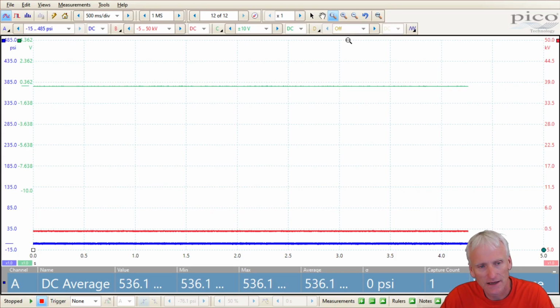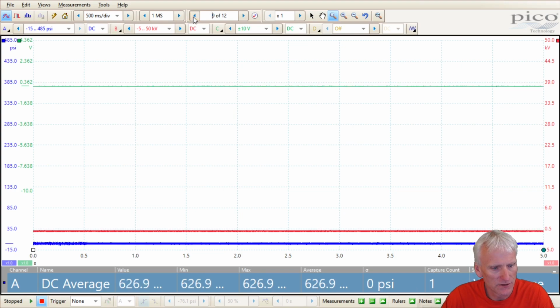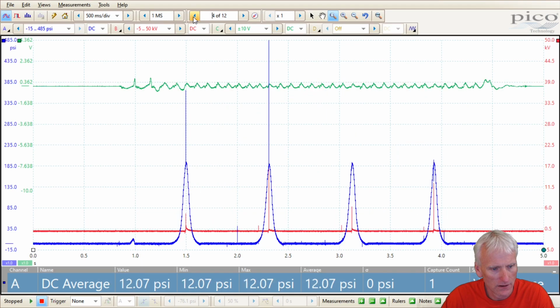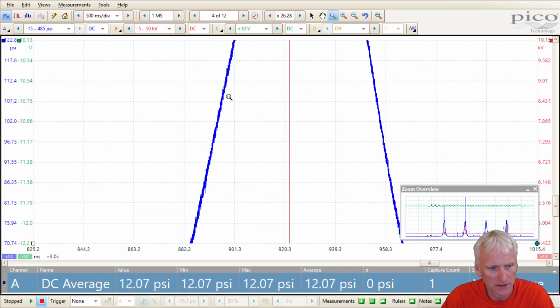This is the SSI Technologies sensor, and I'm going to scroll through this. You can see that's where it was running, snap throttle, and this is our cranking compression right here. I'm going to zoom way in on this. You can already see it's a very smooth line, so we know that this thing is outputting at a higher frequency than these others.